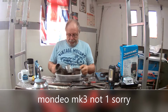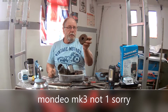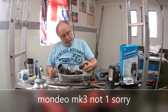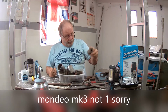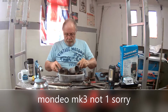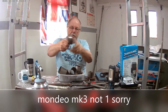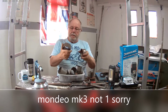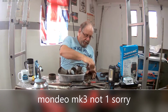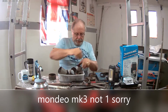Right. Here we go. Look at these. I've got a hydraulic press. These are from the hydraulic press. That's the socket that came with it. All these tubes are bearing sizes. They're all wheel bearings, front wheel bearings. Basically, I just saved the casing, because when you want to shove a bearing out, you put it on that, put in the bearing, put it in the hydraulic press, and it shoves it out. Basically, that's it. They just push bearings out.